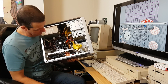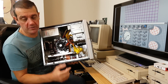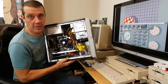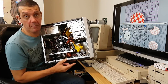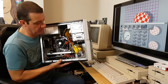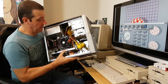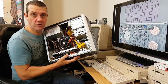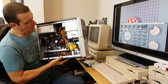It's got a couple of gig of RAM with a spare slot for more, but two gigabytes is plenty for this. I added a 16-bit Sound Blaster Live card — very important you get the EMU chip, the EMU 10K or something like that, I'll put a link in the description. Then an Intel Pro network card, and I've got an old GTX 7800 series graphics card which handles all the graphics.